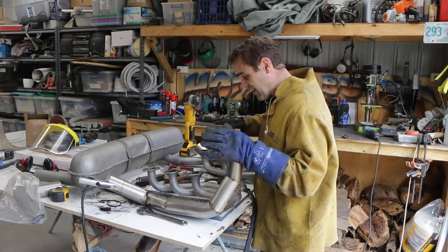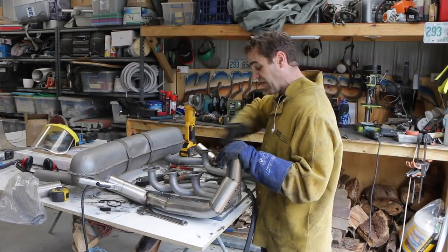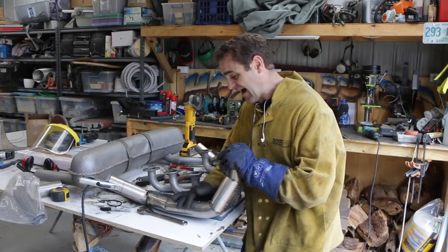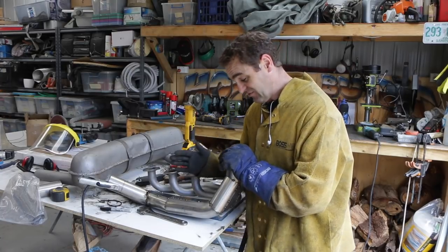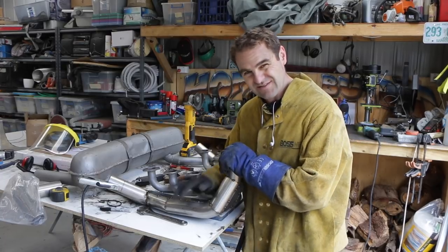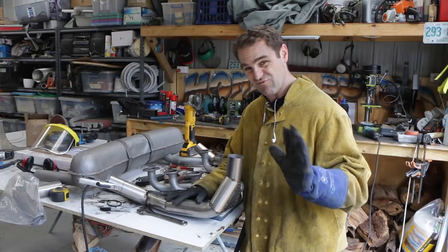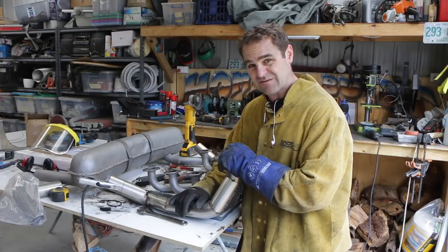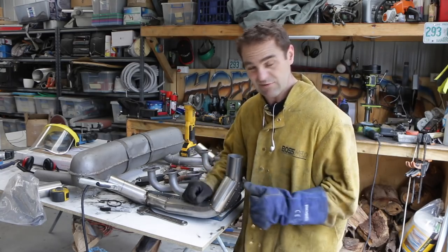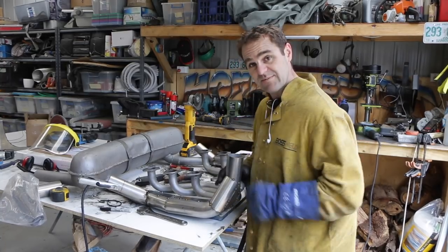We've all been trial fitted up now. I've got everything mocked up the way I want it. Now it's time to go around and weld the whole thing up solid so that it's actually going to work. Something you're going to ask — this is a mixture of stainless steel and mild steel. That's just what I had lying around, and we don't have a big problem with rust in Australia like you do in European countries or North America where they salt roads. A standard exhaust system on a car in Australia lives the life of the car — 30-plus years — and they're generally still fine. So with mild steel, this should be fine. It's time to start welding.